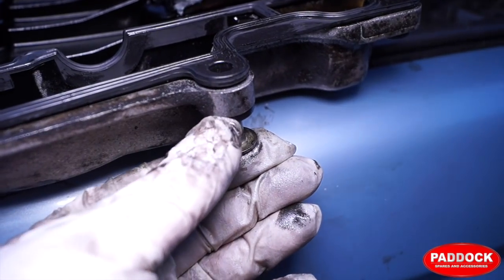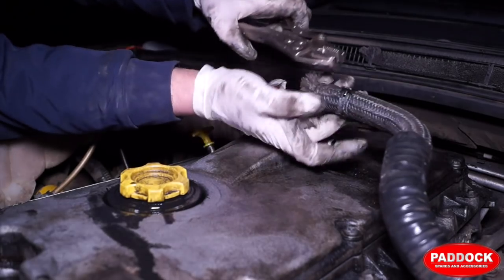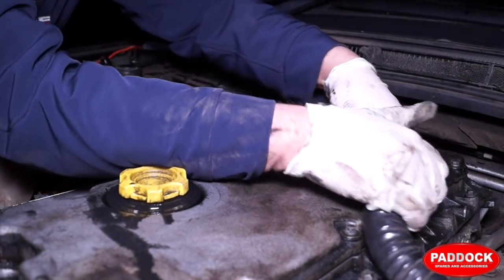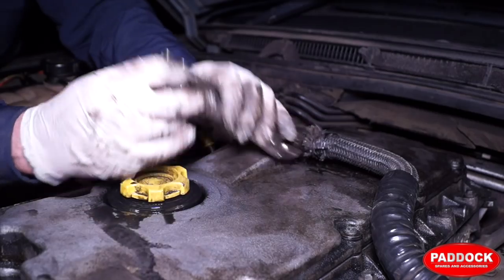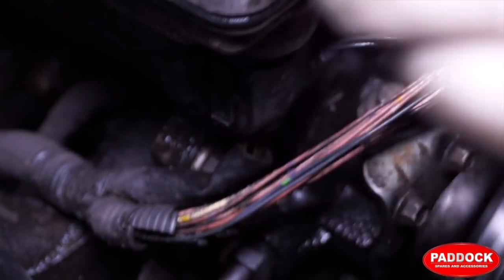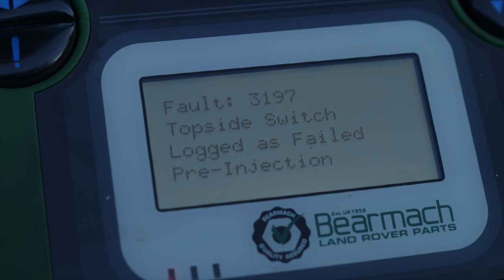Be aware that the ferrules have a rubber insert but they also help position the gasket properly — when you nip the bolts down they will go tight. For the pipe you can use a pair of mole grips on the clip because it is very strong; once fitted just let the mole grips off and it will be positioned. So basically this plug — if it's had oil in it, make sure it's cleaned out, plug it in, make sure your ECM is back in position and your battery is connected and it should be okay. However, with this vehicle we have to go further and get ourselves another ECM and get it programmed.